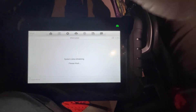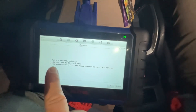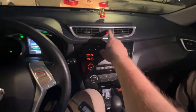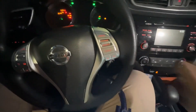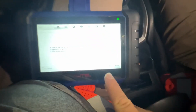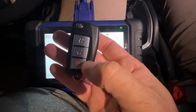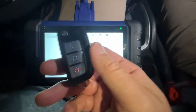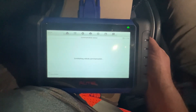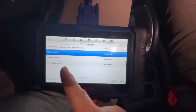So we have key one and key two. Let's go ahead and do hot function. Warning — turn on the hazard light. Open and close the driver door once. Turn the ignition to the on mode. And let's continue. The remote and immobilizer programs all together, not like the older Nissans where it's the remote separate and immobilizer. Key learning guided — pretty simple.